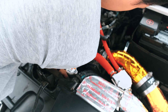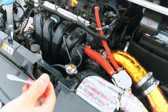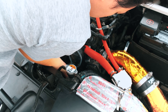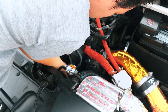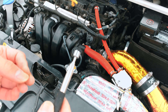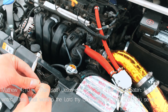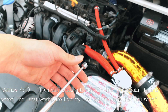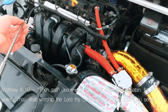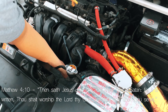I'm going to go ahead and unplug the connector. Use a little flat head - that's going to allow me to pry in that little piece I showed you earlier. It's a bit tricky to do, so those of you with bigger arms are going to have some trouble doing this. Now's a good time to bring this up - this is a little extender with a magnet at the end, about three bucks at O'Reilly. It's really useful if you've dropped nuts down there and don't want to undo all the fasteners for the underbody panels. Get that in there and pick up your tool. And there we go - it's unplugged.